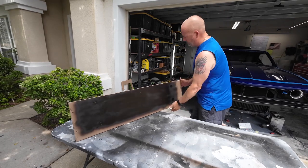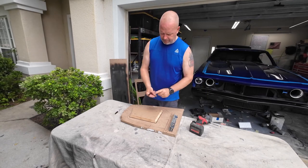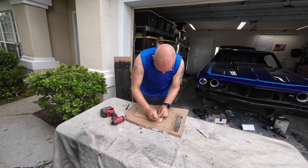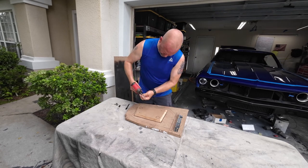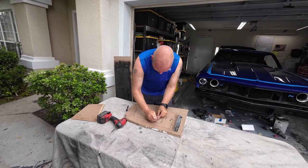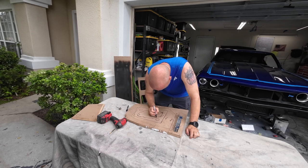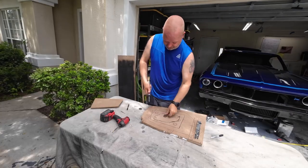This goes on the bottom and back, the amps mount to it, and there's a cover piece that goes over this with another ring on top. So this is the way it was before, and what I wanted was to be able to access those inner panels. We're going to use magnets — I'll drill this like this, use this as a pilot, and mark where the holes are. Then we'll take the top piece out and put our magnet marks in there too, leaving enough room to reach in and change your tail lights if you need to without taking the whole back of the car apart.